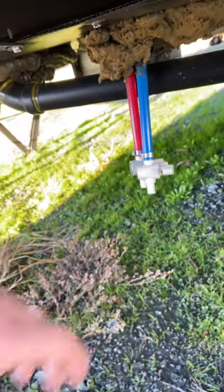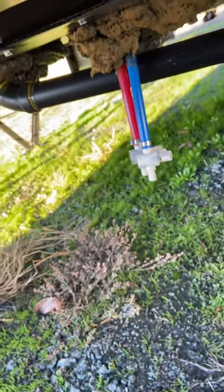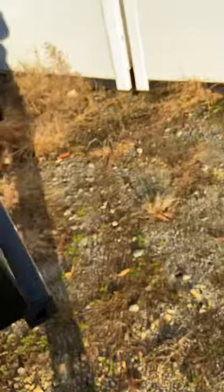I've heard that hot water heaters in these things cost lots and lots of money. The precursor here is that all of your tanks are empty — everything's empty. Even your low point drains, make sure those are empty too. On this RV, turn that valve, turn that valve, let these drain out until there's nothing else coming out.